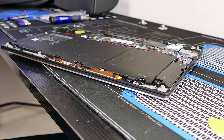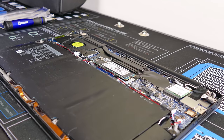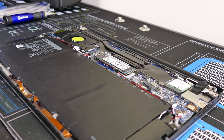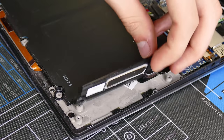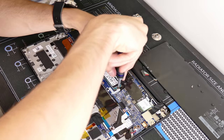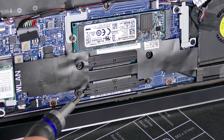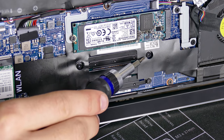It will be latched in a few places as well. With the back panel off, you'll likely find a very large battery to the south along with a motherboard, CPU, and if you have a dedicated graphics chip, that'll be there too, along with either soldered RAM or dedicated memory modules. Depending on how yours is configured, you might have to remove your battery, speakers, M.2 slot, or hard drive to get to where you need to remove the CPU heat spreader. In my case, I didn't have to remove anything at all other than the back panel — you can literally unscrew these four screws and have direct access to your CPU.